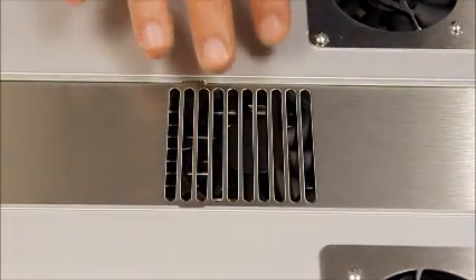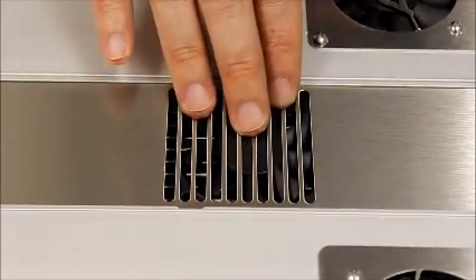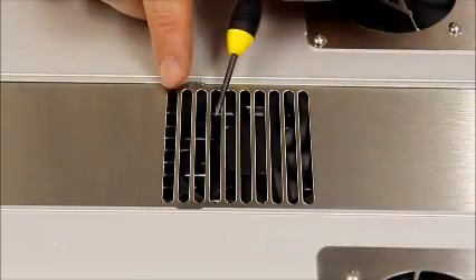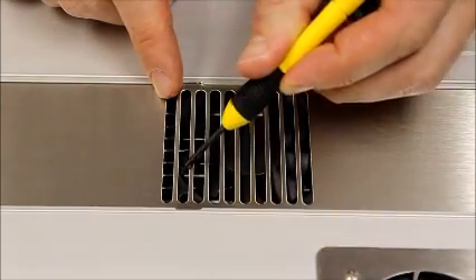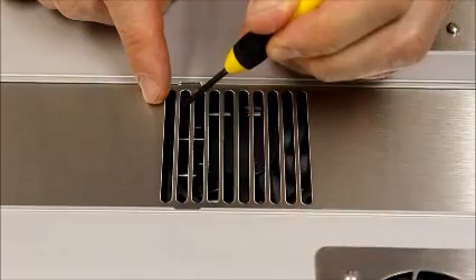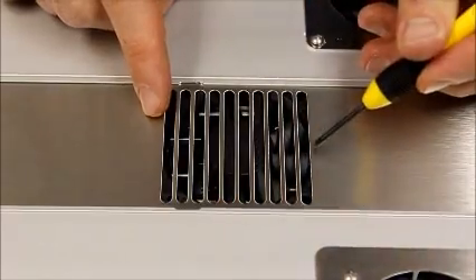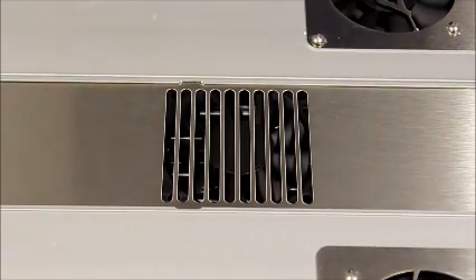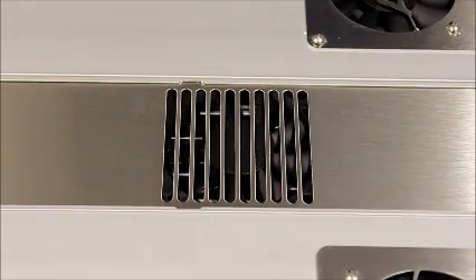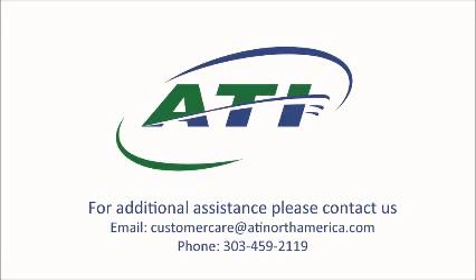Next, make sure the fan for the KSQ we just replaced is lined up with the vents cut in the middle of the metal plate. It may be slightly off — it's hard to judge exactly where to put the fan when installing the KSQ. Just take a small flat-bladed screwdriver and gently push against the fan body — not against the vents in the metal plate — to center the fan in the middle of the vents. Last thing to do is put your end plate back on the opposite side of the lamp cord, tighten it down with screws, and you should be good to go. If you have any additional questions, please feel free to contact us at atinorthamerica.com.